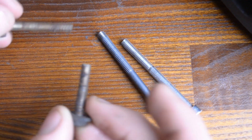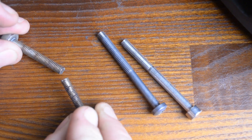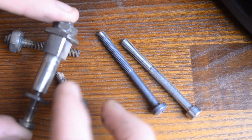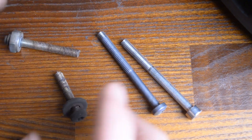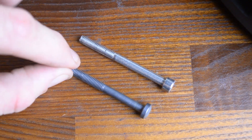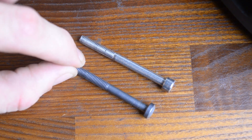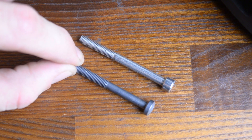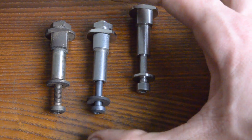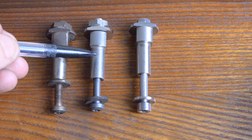What originally came on the car was a grade 18-8 stainless steel fastener. The main failure mechanism was the fastener itself — the rest of the assembly was actually pretty good and well designed overall, and Lamborghini didn't change it in the revised hardware. On the revised recall hardware they went with a grade 5 titanium fastener, which gives you a lot of tensile strength, saves a little weight, and has really good corrosion inhibition properties. That's the same thing I'm going to be using on my revised hardware. Comparative to the original hardware, the recall kit is better by far.